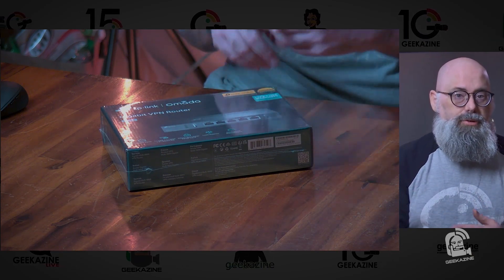You can get to your videos and pictures and have a lot of control at home. The biggest reason I get a box like this is because I like to keep my Wi-Fi router separate from my regular router. You might have a Wi-Fi router with a couple Ethernet ports in the back, but you're putting all your eggs into one basket when it comes to serving your internet or intranet inside your house. You have Ethernet connected devices and Wi-Fi connected devices — put them all into one device and everybody's talking to that one device, which can really overwhelm your router. If the kids are playing Xbox, you're watching 4K movies, somebody's surfing, personal assistants and AI are doing things — a lot of data is coming back and forth. Having it all come in and out of one box technically makes that box the bottleneck.